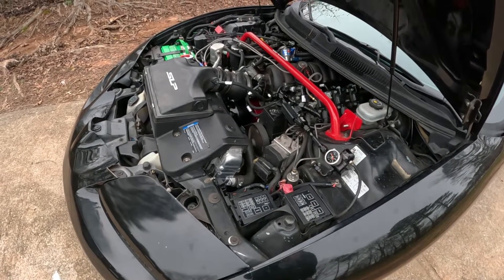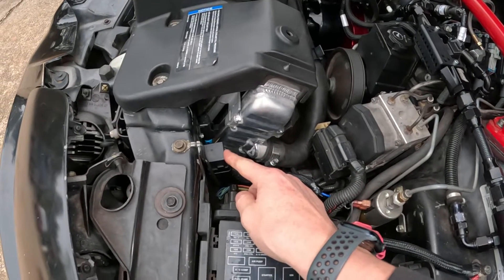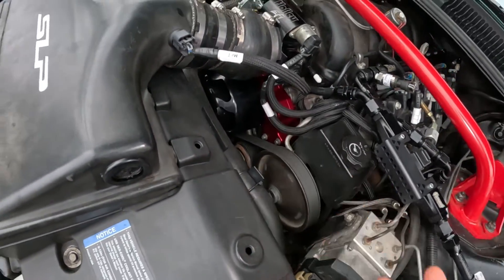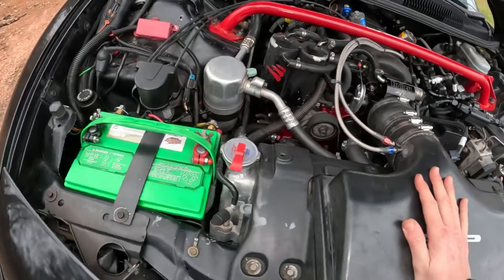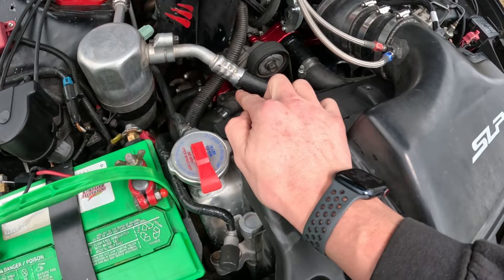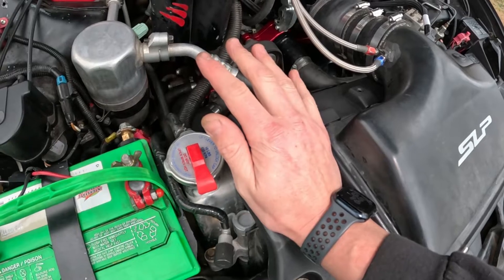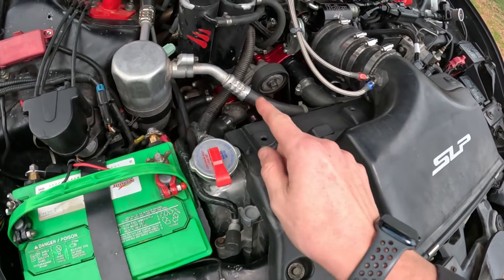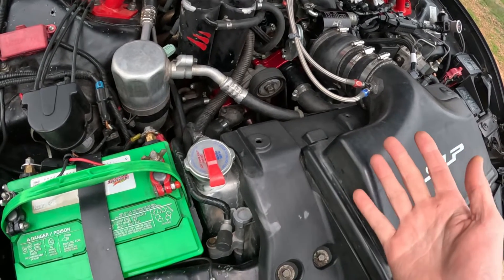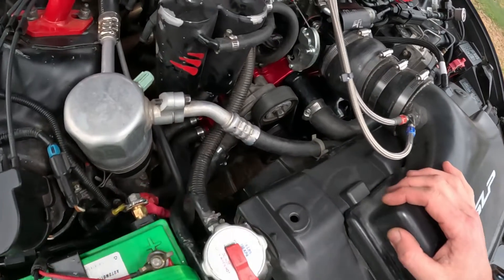I want to wrap up this video on the water pump. I did use a relay and this is the fuse — you can see the water pump here. I did have one leak. I had to take the thermostat off the next day after some driving and RTV'd the thermostat gasket — it's the ring that normally goes around the thermostat gasket on an LS. RTV solves it all — no more leaking.